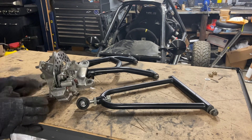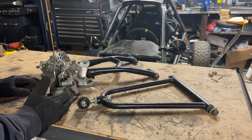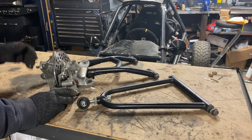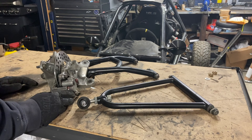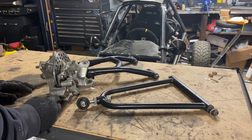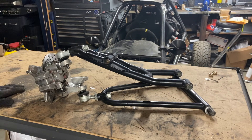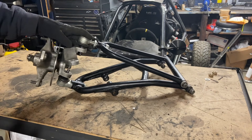I'm still using ATV parts, and that's pretty easy — these things only weigh 200 pounds more than an ATV. If you think the engineering tolerances of an ATV are exactly to their weight, you're probably wrong. I'm sure the tolerance on these is very high. I've driven this black one pretty hard and none of the factory components have given out — not even the bearings. Brakes are solid, you get a brake on each wheel, and this is not a small rotor for a front brake. The best thing is the aftermarket support — you can bolt these right up, have adjustable aftermarket A-arms set up on your cross cart for a minimal amount of money and minimal fabrication.